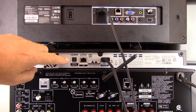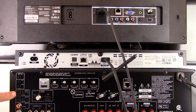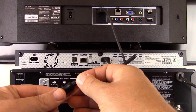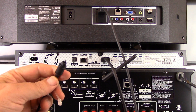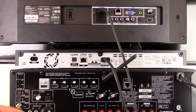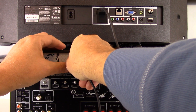In this second method, we're going to connect the 4K DVD player to the AV receiver via the Toslink optical cable. Here is a Toslink optical cable — if you've bought it brand new, there may be a protective cover on the end; gently remove that. Notice the unique shape of the fitting on the end of the Toslink cable, line it up to the shape of the port, press it into place, and listen for the gentle snap.